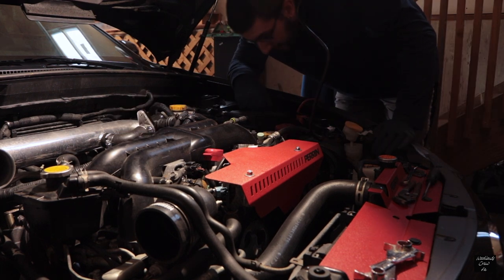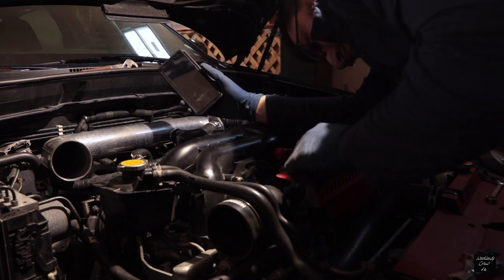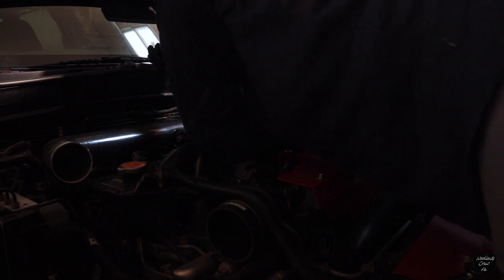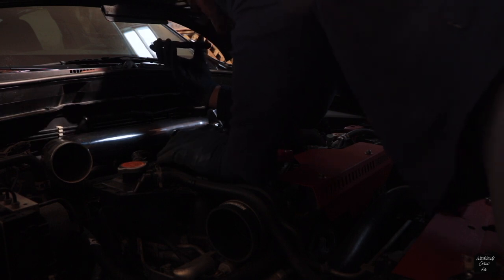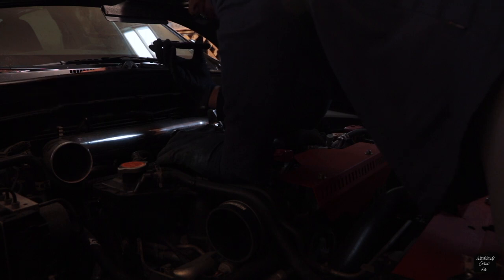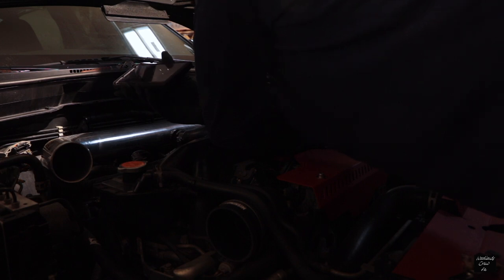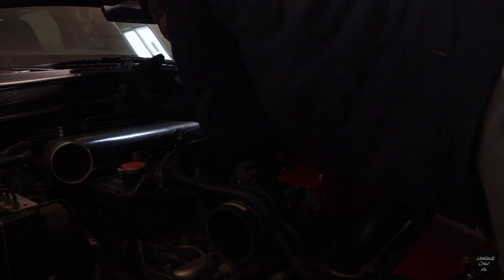There's a tiny little line over here that goes down underneath all the wires. I called John to ask about a product I'm installing — an air-to-oil separator for my 2011 Subaru WRX. I found a blow-by sensor and unplugged it, and I didn't know if I should pull out both the gray and white ends or just the white. He told me to pull the red pin out of the white sensor, fix it back into the gray connector, tape it up, and set it aside — that just tricks the computer into thinking it's still plugged in.